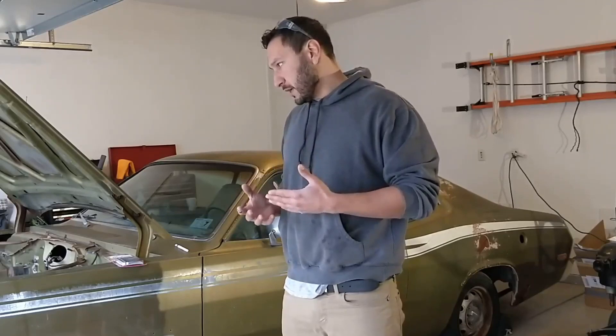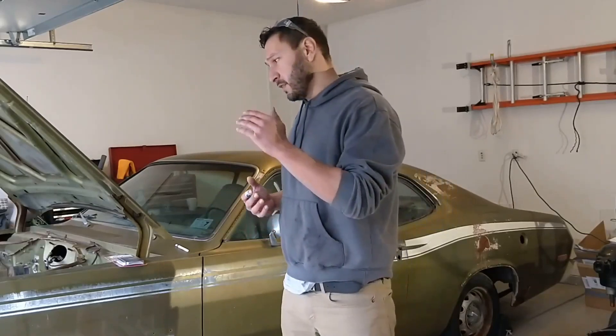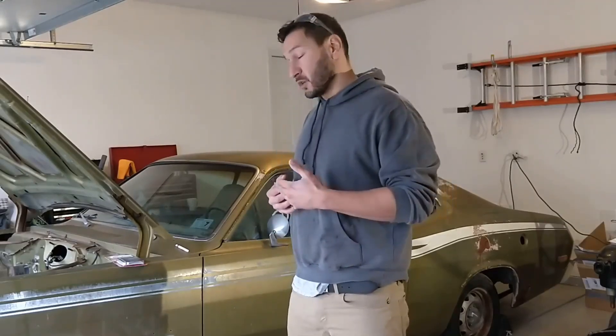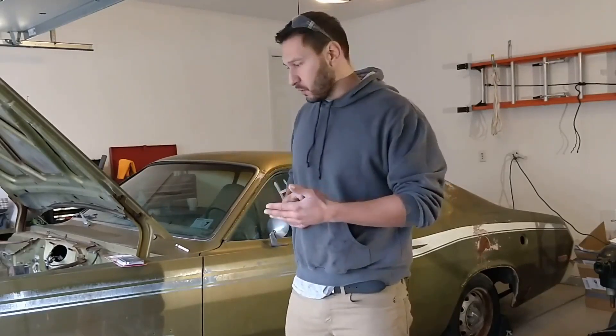What we want to do is understand whether this car has lead paint. We're going to check in a couple different spots and that's going to help us determine the risk level. I'm assuming we do have lead paint on this, but if we don't, it frees up a lot of options for how we're going to do the build — some cost options as well. There's more work we can do ourselves and we're not as worried about sanding in the garage.